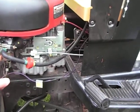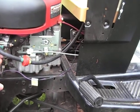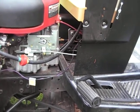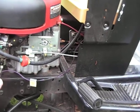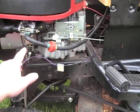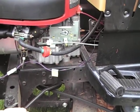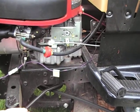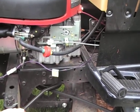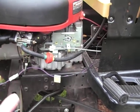The carburetor was clogged. The bowl had a little rough spot right in the center — there's like a pipe or something in there. I didn't see any real water in there, just smelled like bad gas. Slowly took that off, it was a little dirty, cleaned it up real good. The main jet was clogged, got that cleaned out, put it all back together.